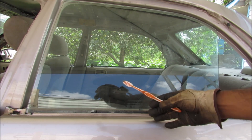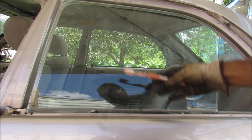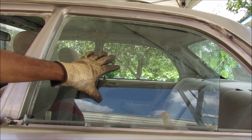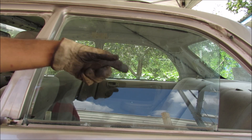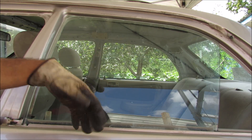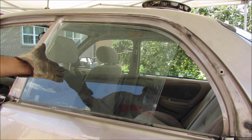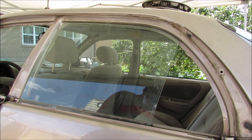Pretty cool, eh? Now the side windows are actually quite a different type of safety glass than the front windshield. They're a tempered glass and they are not laminated. You can see this one is marked as a safety tempered glass. Tempered glass is a heat-treated glass, which strengthens it but also allows it to break into small tiny less harmful pieces compared to larger shards.